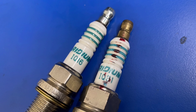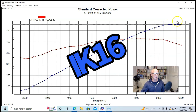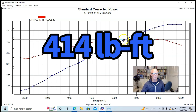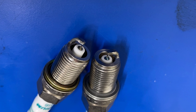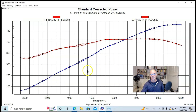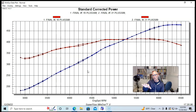These are Denso Iridium IK-16s, and then we compared them to a set of Denso Iridium IK-31s. So a 16 heat range — fairly hot plug, as you can see — I'll show you a picture of the different tips — and then an IK-31, a fairly cold plug. Our power output with the IK-16 plugs was 477–478 horsepower and 414 foot-pounds of torque. Here's what happened after we replaced the IK-16 hot plug with an IK-31, a very cold plug — that's normally the plug we'd run in turbocharged and supercharged applications. If it looks like we just overlaid the same graph, that's because essentially we did. There were a couple of dips and changes where power might have differed, but peak torque was exactly the same and peak horsepower was exactly the same.